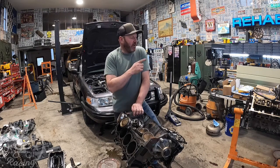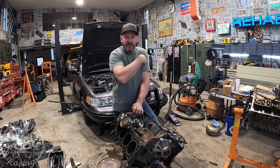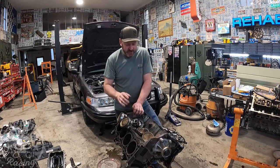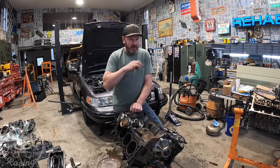So we're going to manual swap it with the new engine. I got the clutch coming, which will get us to where we can get the engine stuff back in the car, and then we'll work on doing the clutch pedal. Unless I decide I want to do an internal slave bearing — I'm going to look into that before we do it. I may have to order that. Normally those T45s are cable, but I'd rather do an internal slave if I can.